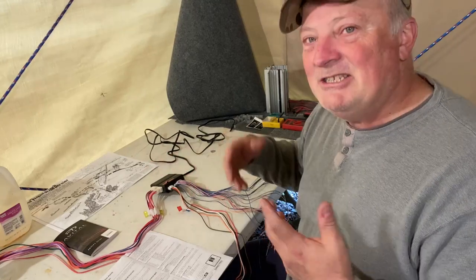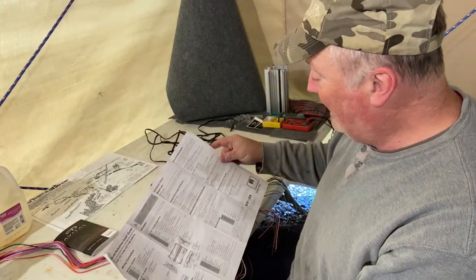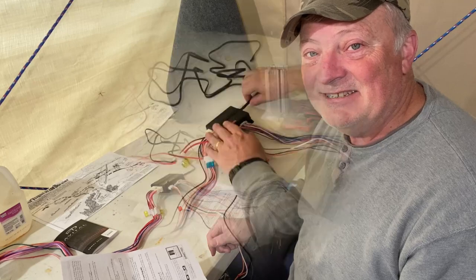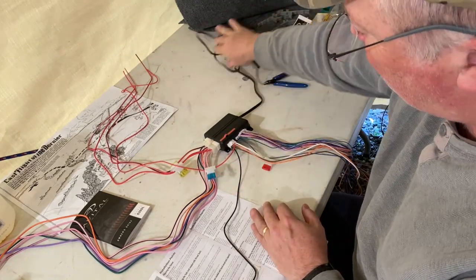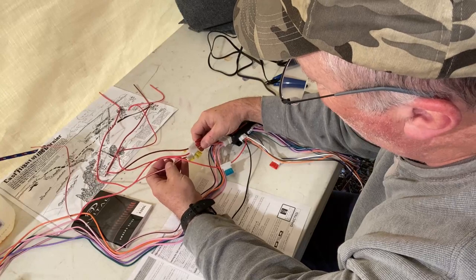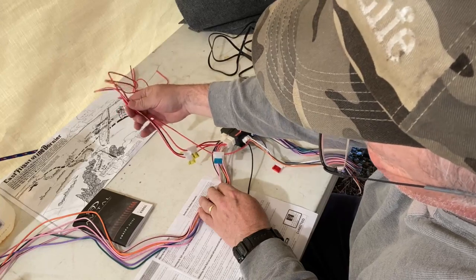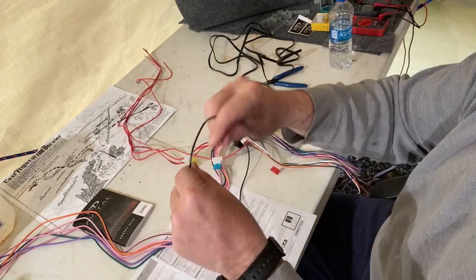I'm not going to go over what all these wires do because it comes with a reference guide and it would take another 10 minutes. I'm just going to pull out the wires I need, strip the ends, and get them ready for installation. This wire goes to the program switch and LED — we've already mounted that on the console. I've isolated all the power: red with black, red, and red with white out of this 5-pin — all supply 12-volt power — so I'm probably going to combine those into one wire. This other one is the ground, which you want to hook up first before connecting any power to this system.